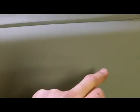And we had some body work in here. We got three coats of MP4 2K primer on there, which isn't a super high build, but it's decent build. And then we had a spot there, a little area there, and then another one right here. And a little waviness along this top, but nothing that I don't think the primer won't take care of. If it really pisses me off, I'll feather fill it. But that's where we're at for now.